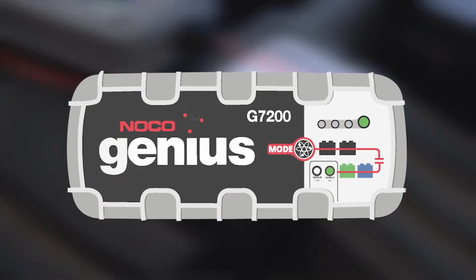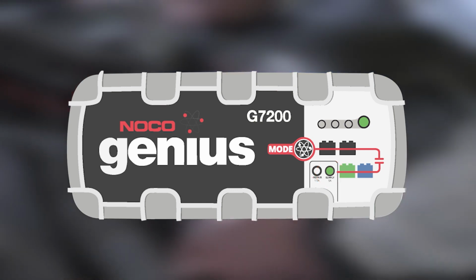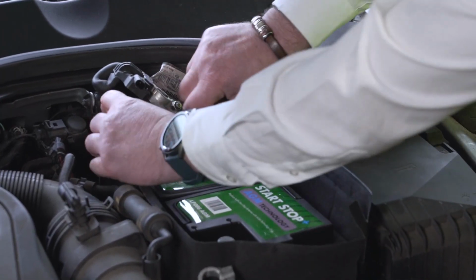The charger has a supply mode, which means in this setting we have a constant supply going into the car. To put the G7200 into supply mode, simply hold down the mode button for up to 5 seconds. Now that the car has continuous power, we can safely take out the old battery.